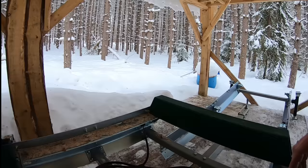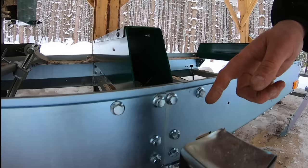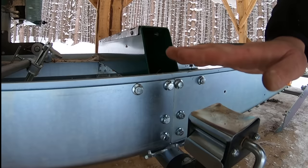Another thing you'll notice here, there's lots of slack with the wire loom. And so it's going to allow me to run that extension on the trailer and not have any problems. So I'm using an impact driver here just to make things fast. One thing I got to make sure is that I leave this jack in place. I don't unbolt it on this side because I want this obviously to hold the weight of the trailer as well.